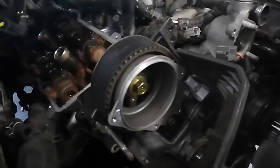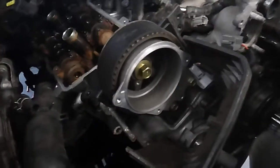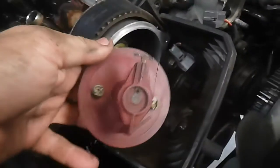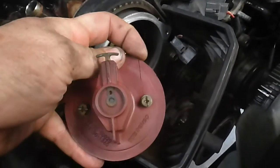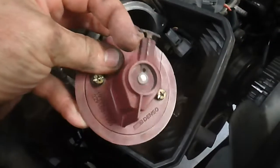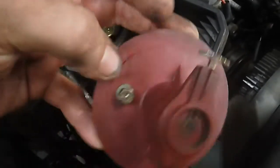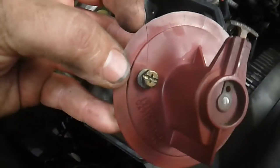I'm just going to talk about the rotors. The garage pulled this car apart, replaced the cam, looks like they've done tensioners and a water pump. They didn't do the rotors. You can see here — there's a big crack there, up around the edge. It's falling in pieces, it's cracking. You can't really see it until you get in there. Yeah, we can see a bit of the crack there, and on this side there's a big crack.